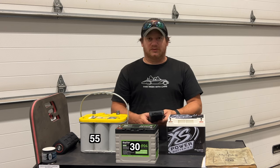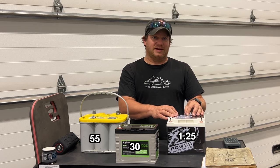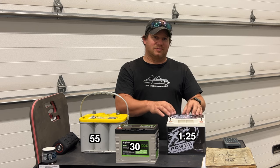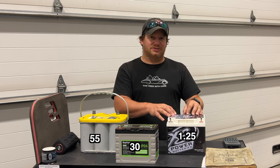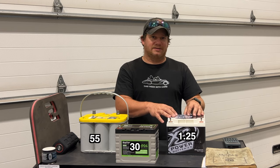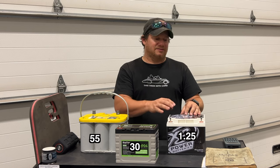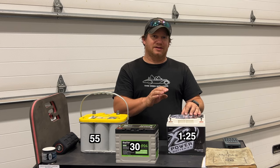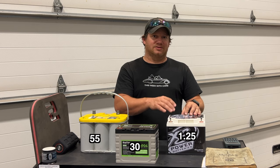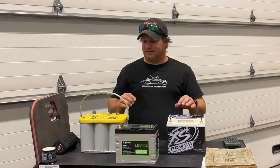If the power delivery is more consistent and feels more powerful from the lithium battery, it may be okay that it doesn't have the capacitance of the yellow top. The ultra capacitor doesn't give an amp-hour rating — it has a watt-hour rating of 16 watt-hours. Using 12.8 volts, that gives us a capacitance of only 1.25 amp-hours. But the amount of current it can output all at once is crazy, which is enough to start an engine even with so little stored energy.